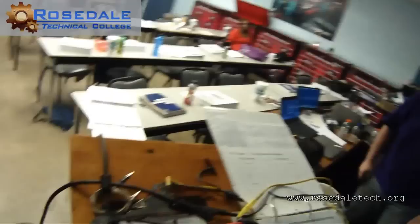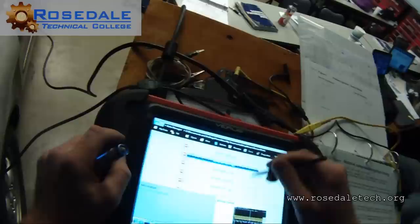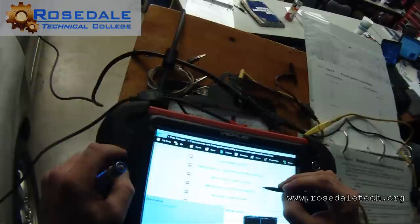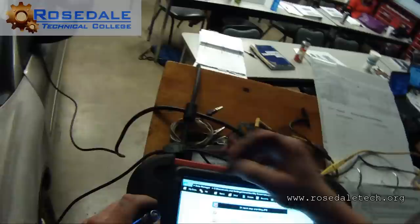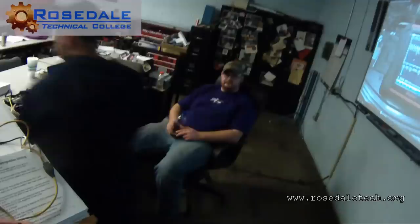So can I look real quick then if I hit the home tab, data manager? What'd you name the file? I don't see it. Jeremy, when you took a picture, did you press the... I'm guessing you guys did it under the scope multimeter is my guess. Yeah, we did. All right, so you see it's a .bss file. You will not be able to open that file on a regular computer. You'll need ShopStream Connect from Snap-on, which is a free download from them.